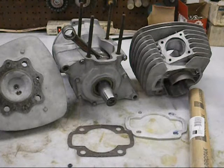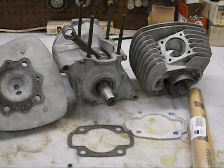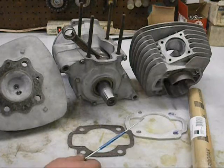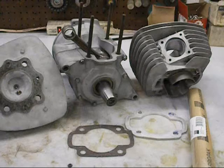We've got a stock gasket here and we had to get some gasket material from Felpro. They don't make it in 20 thousandths - I put some calipers on this and it's 28 thousandths, and believe it or not, 8 thousandths means a lot. So what I'm going to do is take 8 thousandths off of this plate so it won't know any difference that it's got a thicker gasket.